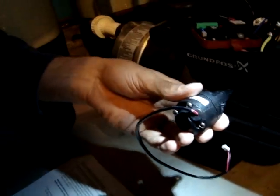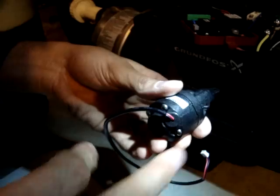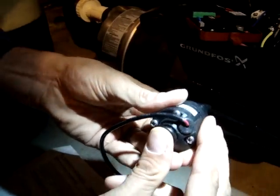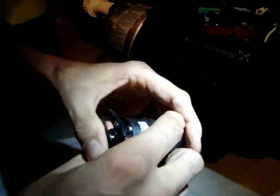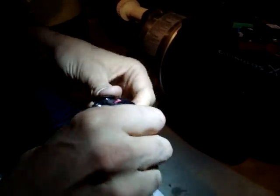This is where I get nervous past 90. They're preset at about 25 to 29 PSI and we're going to take it up to about 35 to 40 PSI, but we don't want to be over 40 because that'll keep the pump from shutting off — possibly you could have to do it all over again. When you turn it you're actually turning that screw inwards clockwise. The guy who winds up doing it all the time remembers — it's like a pressure regulator.